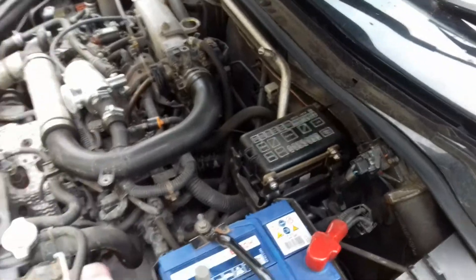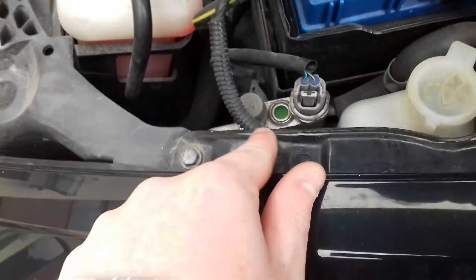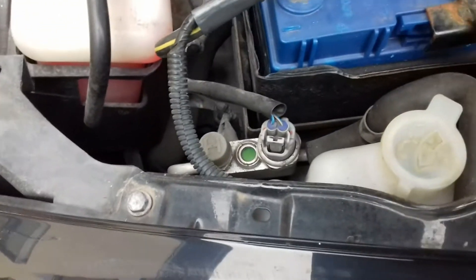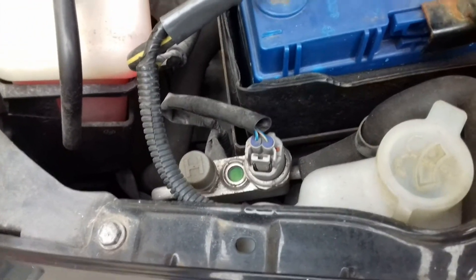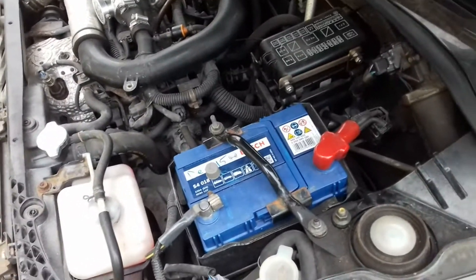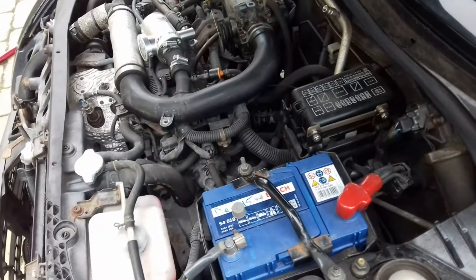That's it done. So I've removed it already — it went up to the green mark in the canister, so it took about 10 minutes, not too bad. And one thing you should note is this little viewing window — you'll know for a fact if your AC coolant is low because you'll see bubbles fly past. I wish I had taken a video of that, but I'm one-handed. The only thing left is to put the dust cover back on the low-pressure port. The temperature did go down from about 20-ish to about 15, so that's not too shabby. Take it slowly, squeeze the trigger, shake, squeeze, keep doing that over and over again, and Bob's your uncle.